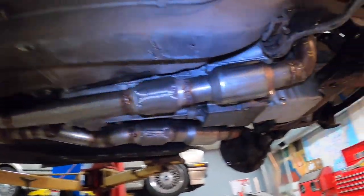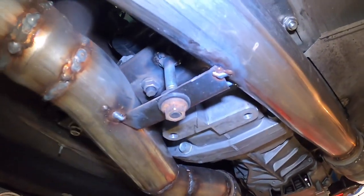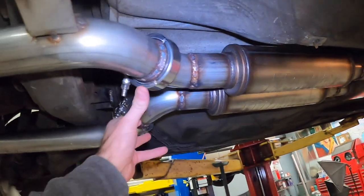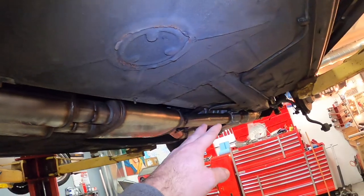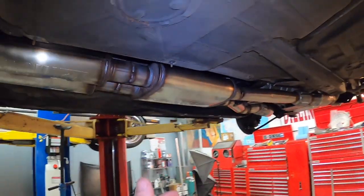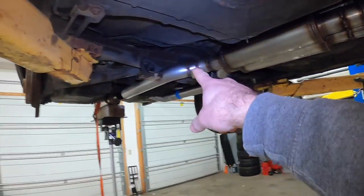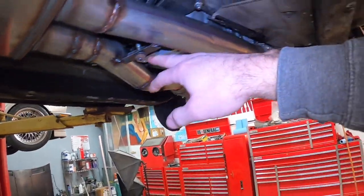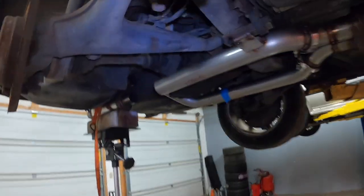This is fully welded up. I added another hanger right in the center to hold this in place for installation, because there are v-bands here and the hangers are on the backside of the v-band. It's going to be really difficult to get this centerpiece in by getting those two exhaust downpipes on as well as getting this set into place without the hangers. You can use the hangers and the v-bands with this center hold to get the center section installed.